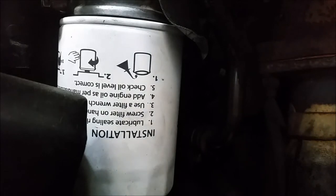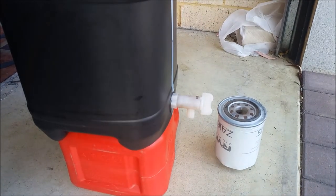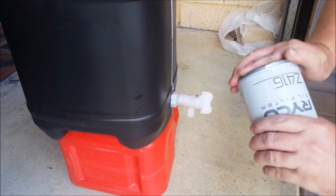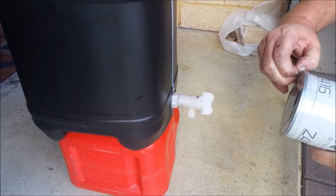The oil filter is located on the right-hand side. Once we've got the oil filter off, give the mounting surface of the oil filter a really good clean, just to make sure there's no gunk left inside. Have another feel with your hand. Next, we'll take our brand new oil filter and we will put some oil into it.